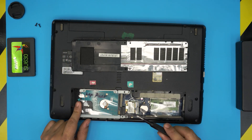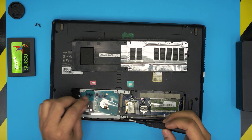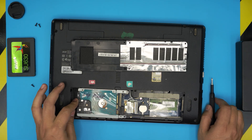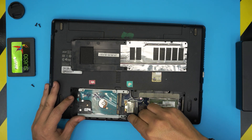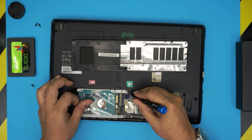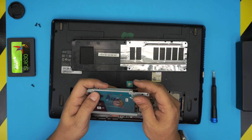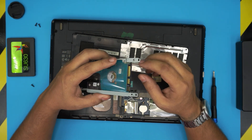Down here the hard drive is right over here, held down by one screw — remove that screw. Once removed, slide the hard drive towards the left side. If it doesn't come out easily and it breaks the paper bracket, don't worry or panic. Just push it from here to the side, gently and evenly — a little bit up, a little bit from there — and it will come loose. Sometimes when you pull you can separate it; it's not really hard.